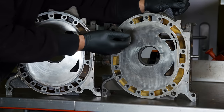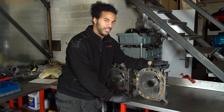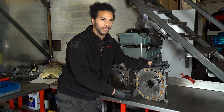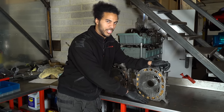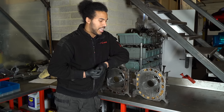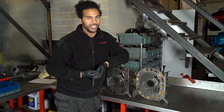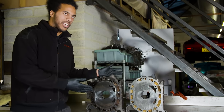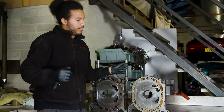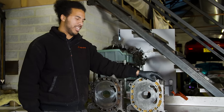A full bridge is created from these two eyebrows here — the bridge is where the apex seal runs freely across the ports without falling in. The additional eyebrow-shaped holes allow more air to come in, which means you can add more fuel, which means more power. Think of it like a high-lift cam — you're increasing the diameter of a hole. Peak torque shifts further up the rev range due to that overlapping effect from the porting, and peak power shifts up as well. Figure-wise, we've seen anywhere from about 190 to 215 at the wheels on our dyno with these ports.